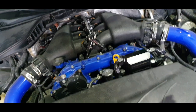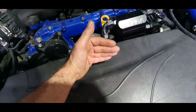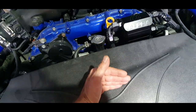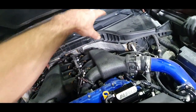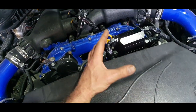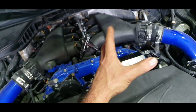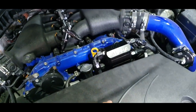I told the owner last night. There is a different clearance between pressure plate, clutch, and flywheel. There's a different clearance between clutch release bearing and pressure plate, and there is a difference in the stroke for the slave on the master cylinder and on the pedal. Like I said, it doesn't matter what you do on the pedal, even if you double the stroke, you're going to end up bending everything, because there is no other movement inside of the pressure plate.